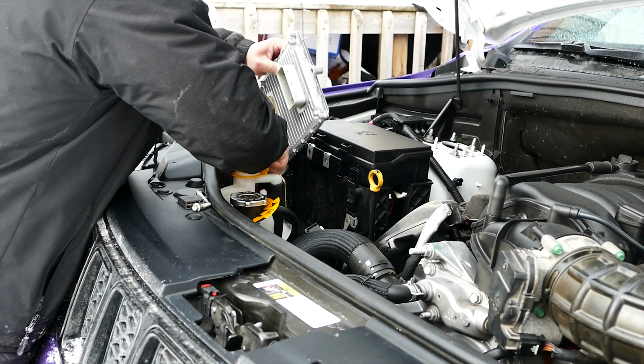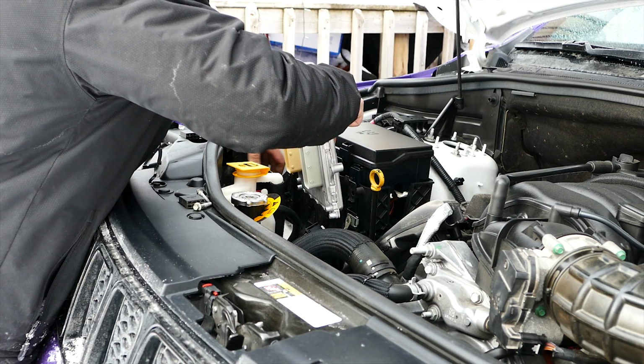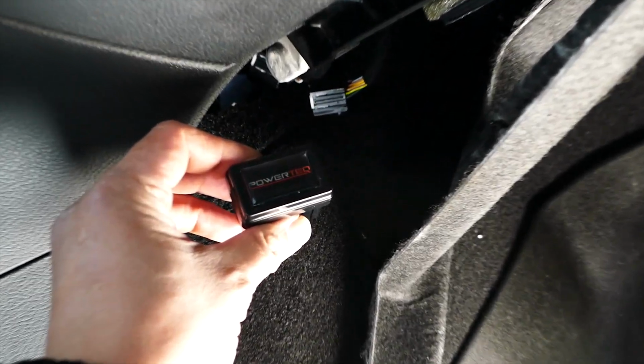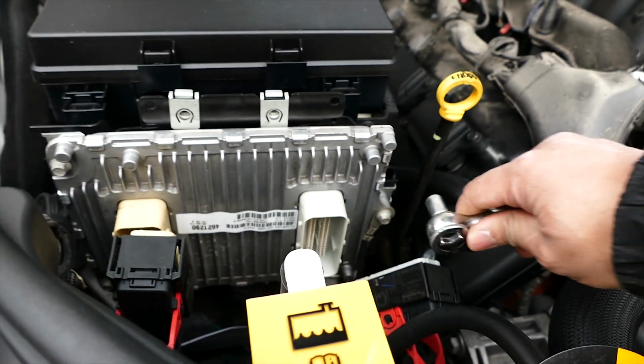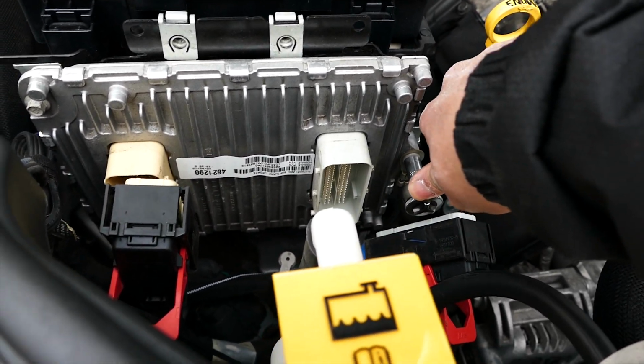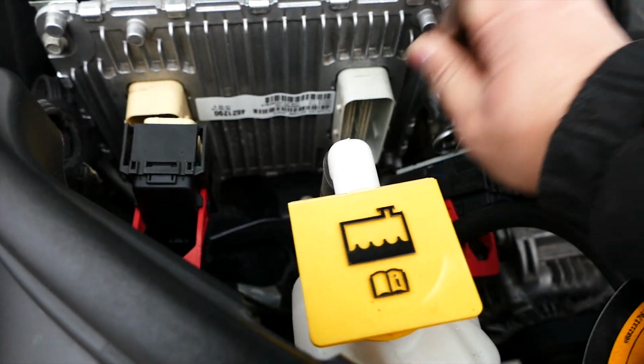They do happen. Okay, so unlocked PCMs and security bypass modules are required for tuning for the 2015 to 2021 Dodge, Chrysler, and Jeep vehicles. So we're going to assume that you've already swapped your factory PCM with an unlocked one, or that you have a Mopar between 2005 to 2014. For the 2015 and up Mopars, y'all can check out our PCM swap episode link in the description and in the comments below.